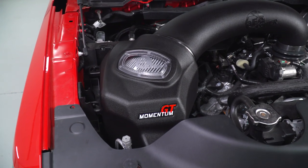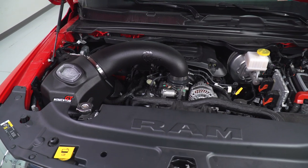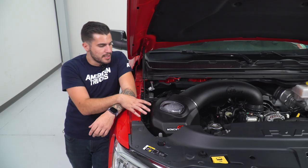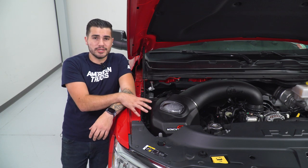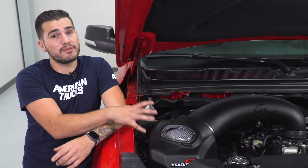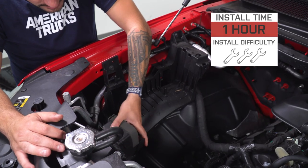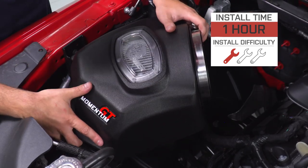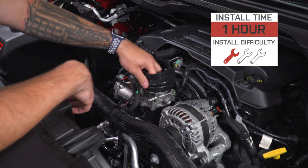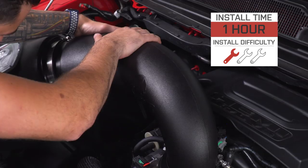Because this has a completely enclosed heat shield — which a lot of options in the category don't — and a huge upgrade in the filter department, it does carry a slightly higher price tag, falling around $450. There are options out there for $350, but you won't be getting an enclosed heat shield and you might not be getting as big of a filter, which plays a huge part in the performance difference. The install is gonna get one out of three wrenches on our difficulty meter. Anybody can tackle this in the driveway at home with about an hour from start to finish. Cold air intakes are some of the easiest things you can do to your truck, specifically under the hood. I'm gonna show you every step of the process with very simple hand tools.